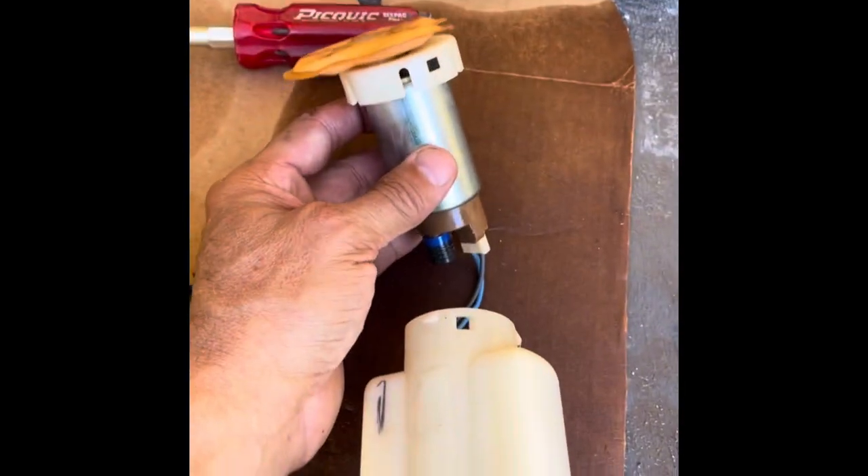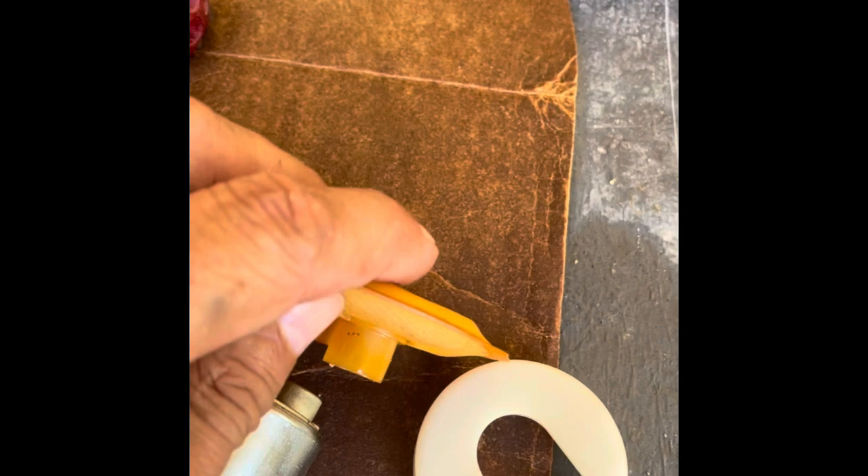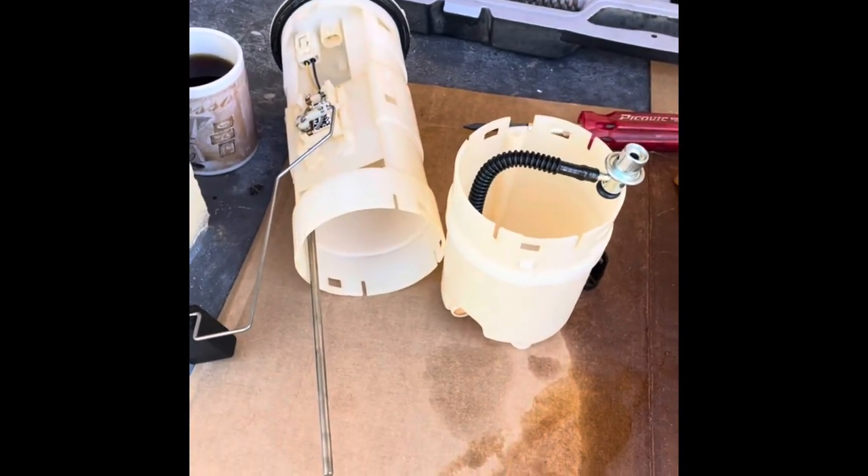This one's a little challenging. We had to push the pump out of there because we couldn't get the filter off any other way. We got the filter off — it just pries off of here. It comes apart one way and should go back together one way. We'll look inside the tank — put the camera there and that's inside. We're still full with gasoline. The black piece is the base of the pump, and one of the little knobs of the feet — I'm not sure if I'll be able to get that.